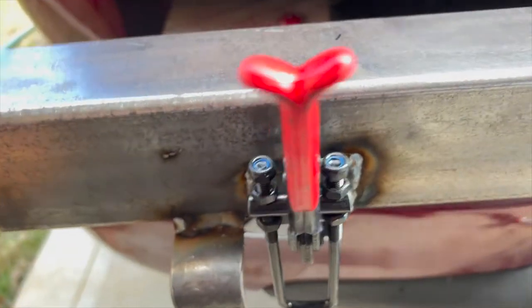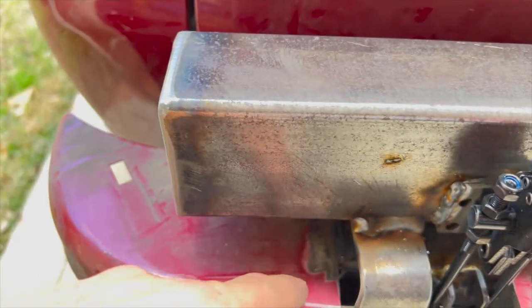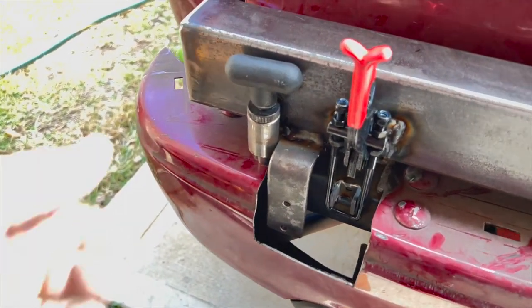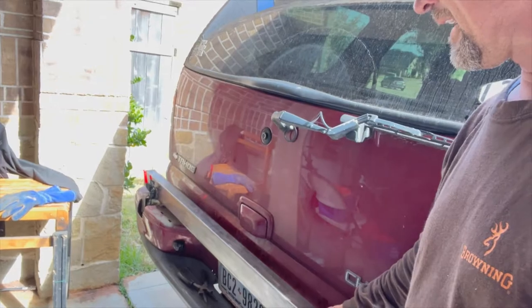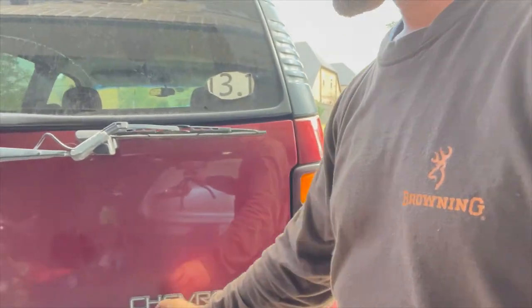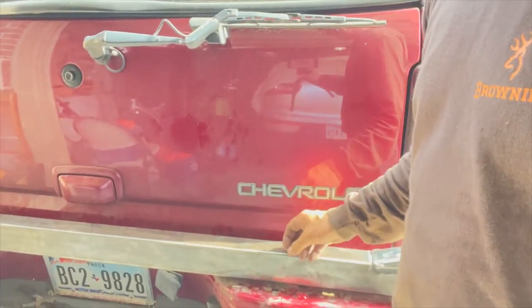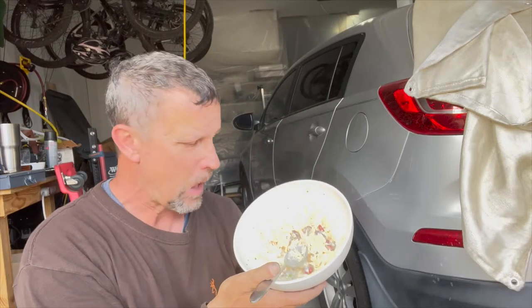Catch, latch, and stop are in. I think I'm going to put another pin here — drill a hole right through the tube and the bracket, and it'll just pop right down into a hole there. First though I'm going to pop the tire on and figure out positioning. We don't want the tire covering the light, so the right side of the tire will be positioned here and low enough that we can open the back glass. I'll have a short post coming up into the tire, put a tire plate on, and get a couple of support angles down to the side for stability. But first — I am starving, so I've got some chicken salad and Triscuits and I'm going to eat before continuing.